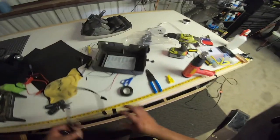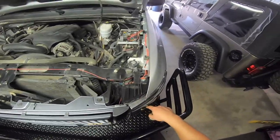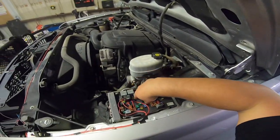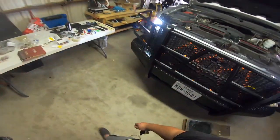Sorry, my camera died on me there. So what I ended up doing — and you guys saw pretty much everything — I was running the wires through here. I put a small zip tie right here and grounded it to the same ground as the daytime running light I just put in, then I ran all three wires right here. I hooked two up to the daytime running lights, and then I hooked up the three markers up here to the right headlight, so whenever the right headlight turns on, it'll turn on.